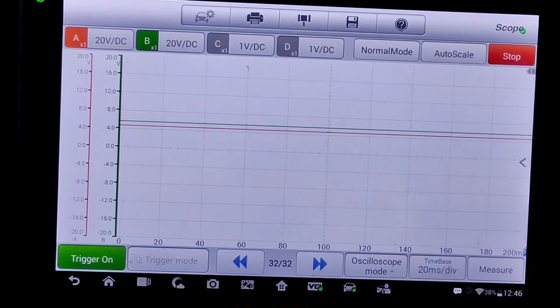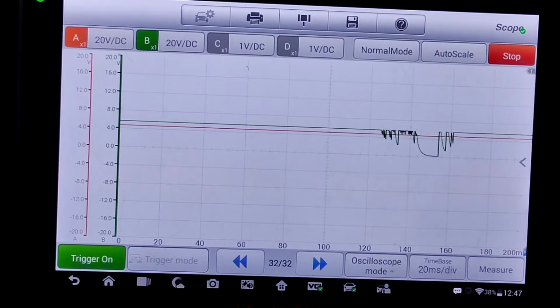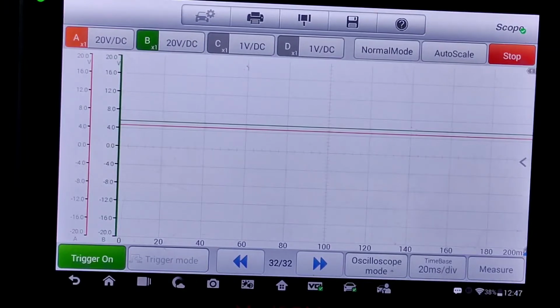What I'm going to do is a wire wiggle test. I'm just going to move these and see if the values change. Move the connector around. What did I do there? Something happened. Is that me, because I touched it? Okay, so right here I touched the connector, the piercing pin going directly into the wire. That's why that happened. So I just have to be careful.